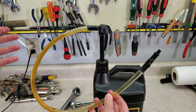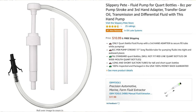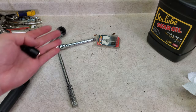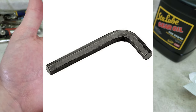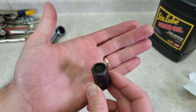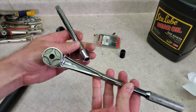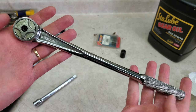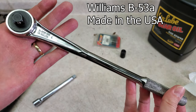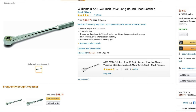Rather than the hose method, I like to use these gear oil pumps that screw onto the bottle. They just make it so much easier to fill the transmission. For tools you'll need a 17mm hex tool — you could use a 17mm Allen wrench, but I personally like these sockets that you can use on a ratchet. And of course a ratchet and some extensions. This is a 6-inch extension, and this is a nice extra-long 3/8-inch drive Williams ratchet. Williams is an industrial brand made by Snap-on. This ratchet is pretty affordable, I've had it for several years, and I really like it.